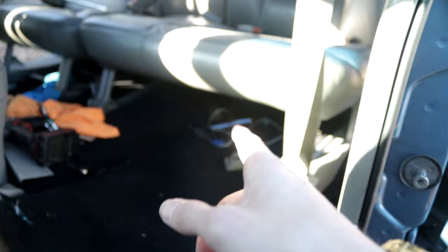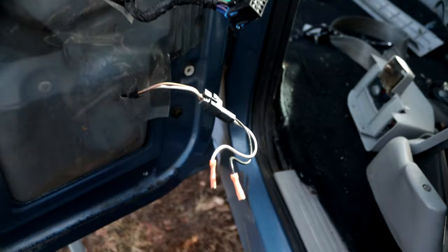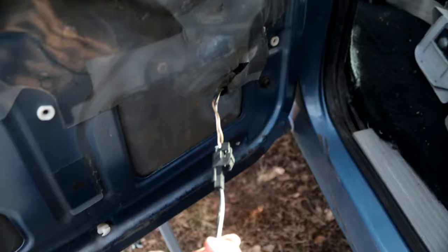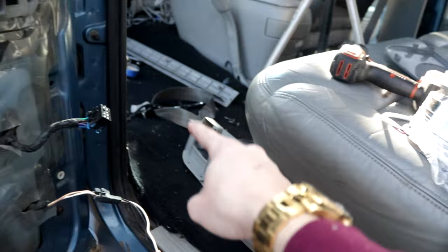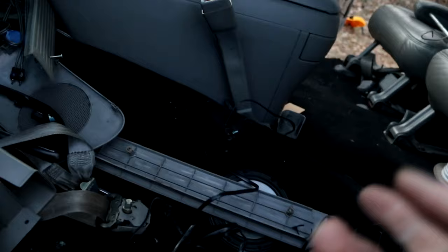Now we're going to get our speaker wire. We're going to have to start taking some of these panels off and getting our speaker wires ran to each location. Now we're down to the factory wiring here. This right here is factory 16 gauge. I'm going down to 14 gauge — some OFC marine wire. This is waterproof, but you could get by with the 16. I just want the extra security of the 14 gauge. With running new wire I can run the wires straight to their source now that we don't have to run through the head unit anymore. These wire runs will be way shorter going to each location and should give us a little bit better sound. All front four speakers, back doors and front doors are ran through all the factory grommets.